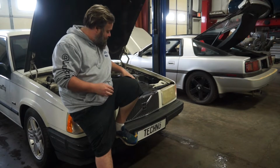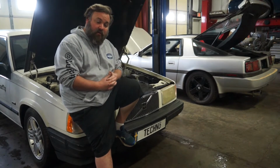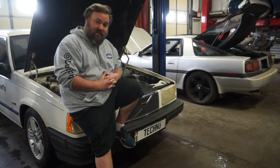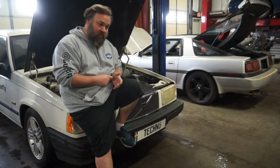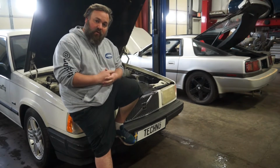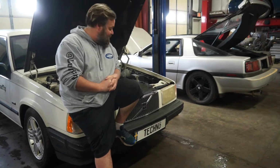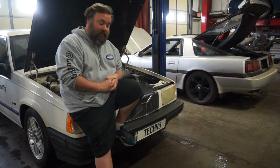The fuel that's in this thing is Costco branded, and not to say anything against Costco, but you never know what you're going to get. The amount of people that are getting fuel these days is extreme, so any kind of sediments that are getting in there from pumping fuel, unpumping fuel, pumping fuel, that gets into your fuel system, so you never know what it is contamination-wise that gets an injector misbehaving. So, whenever you're going to do injectors, make sure you do your fuel filter as well.